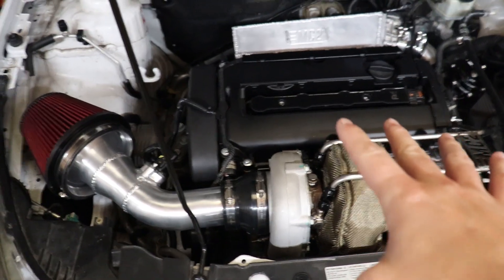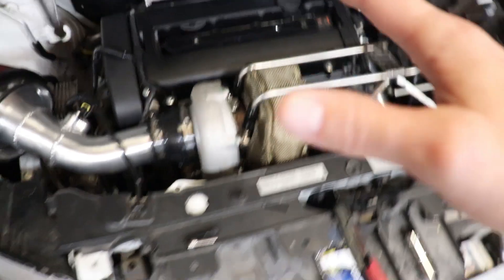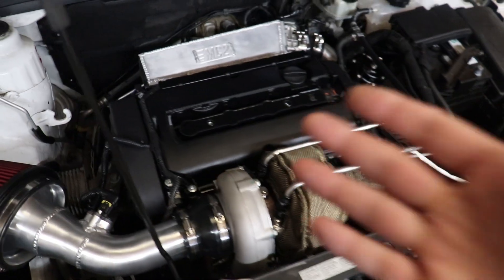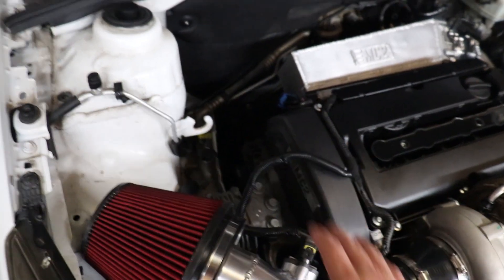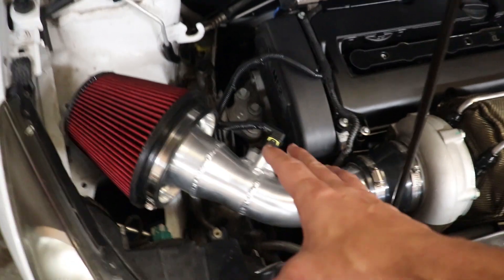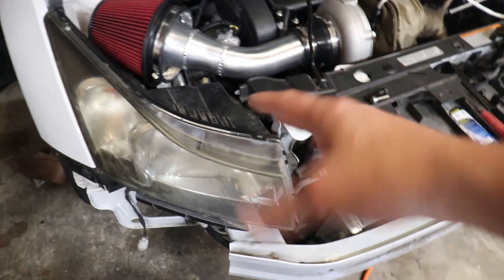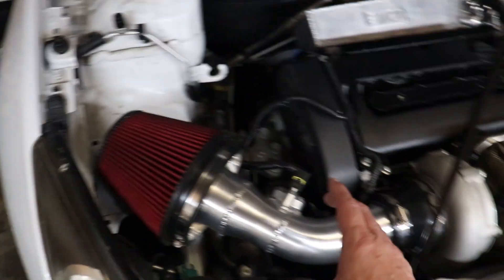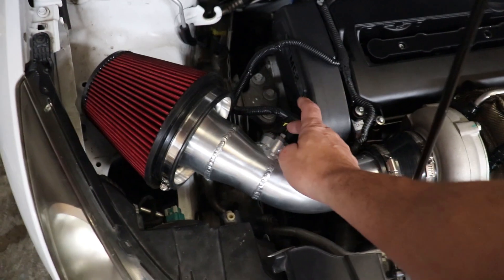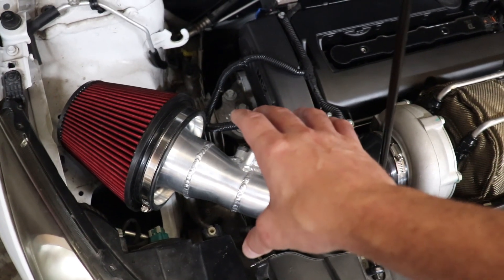Here is the car's current state. Some of the things that have been done since my last video: we got the intercooler all taken care of. I'll leave a link in one of these corners showing how I did that. What I did is I shortened this down, kept enough length so that if I want to take it to a track day I can just turn this thing around and take the light out. Maybe we'll make a custom induction where the light is. That'll give enough room to flip it around, and if I decide to keep the mass airflow sensor as part of the system, we can do that.